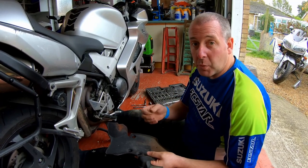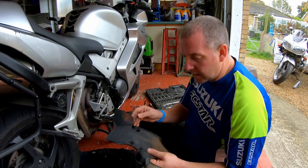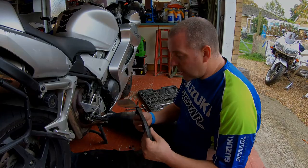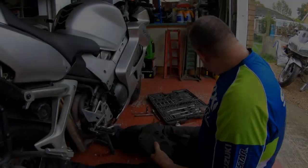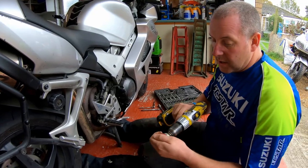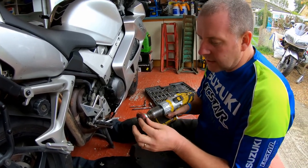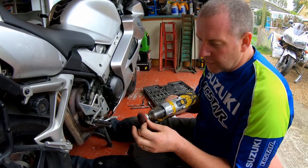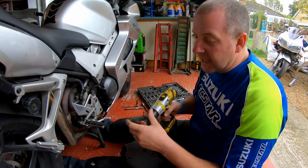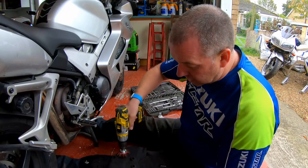The Hydrate 80 will do its thing and get rid of what I couldn't get rid of — it basically neutralizes the rust and gives me a good surface for painting. What I've got here is my drill with a nylon abrasive attachment. These will do a good job of getting rid of the rust but won't dig into the actual material itself.